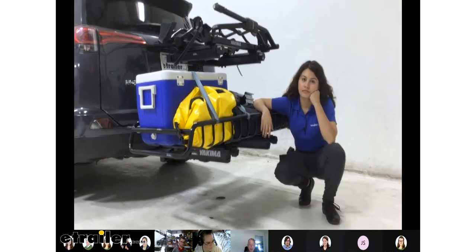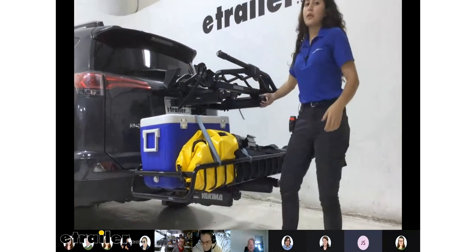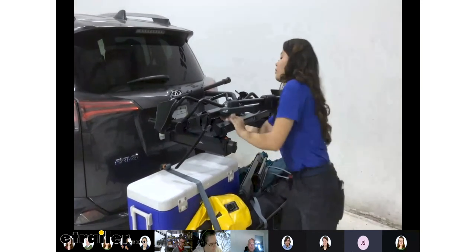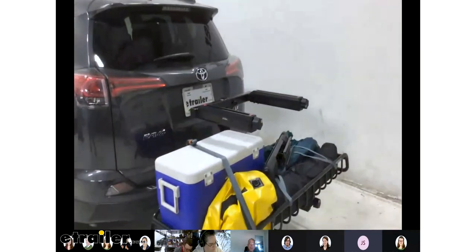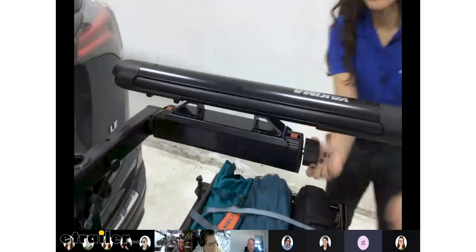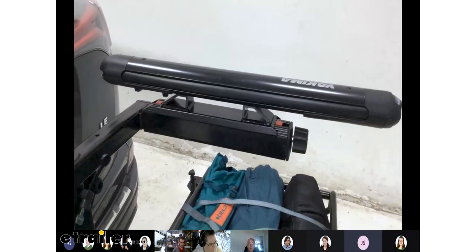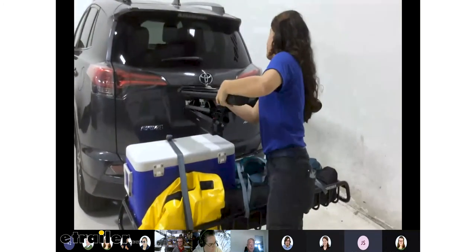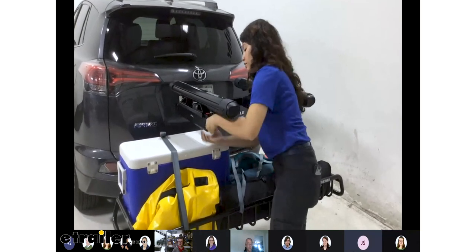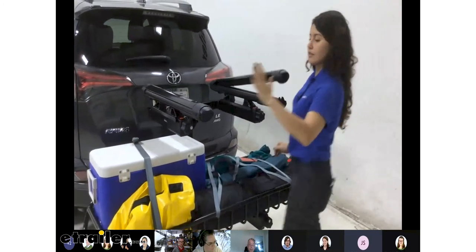Can you remove the bike rack and put on the ski rack quickly? One thing about the top shelf is that it does add a bit of weight, but yes. First you lock it open, then lift your bike rack off. The snowboard carrier comes in two parts — here's one that just slides into those tracks, then you tighten those cleats down, and lock that tab into place. Then here's the second one. The tabs only turn when it's fully tightened down, which lets you know it's fully secured. And that's it — ready to move.